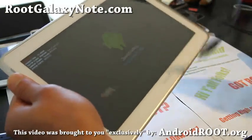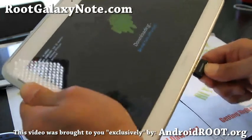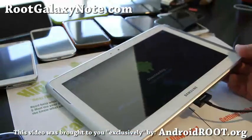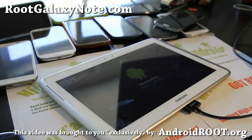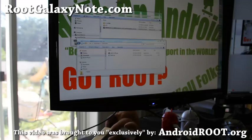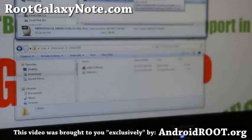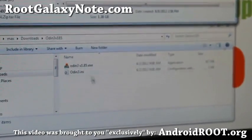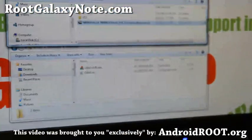Connect your Samsung USB cable to your computer. You'll need a Windows computer for this — I highly recommend Windows, or you can use VMware on Linux or Mac and run Windows inside it. Go ahead and download two files: Odin V1.85 — unzip it and you'll get the Odin program. I suggest version 1.85; I like the older versions — if it ain't broke, don't fix it.